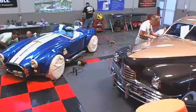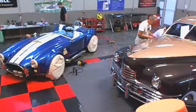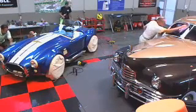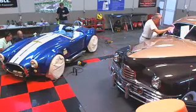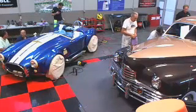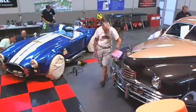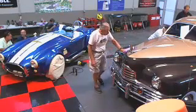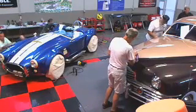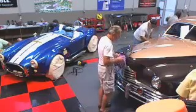Reading your book, I'm sorry for cutting off. It was like I was reading your book. You were talking about the amount of pressure that you can apply to your machine while you're buffing the car. And it went on to say it brings out more luster. Well, the primary thing is if you're doing any of the polishing or compounding steps, you want to engage the abrasives with the paint so they take a bite out of it. Then as you start to work up in how aggressive your polish is, you're using less pressure, because what I always tell people is polishing paint isn't a grinding process, it's an art form. You just have to lessen your pressure as you work through the process.